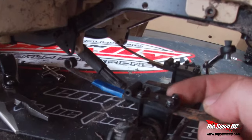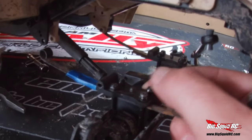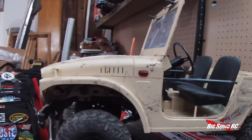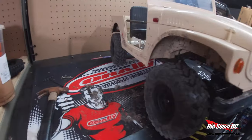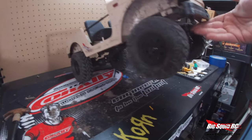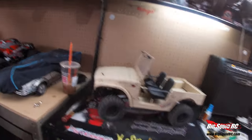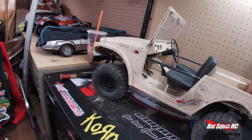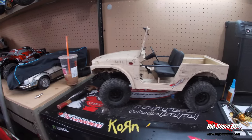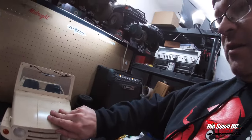These little plastic U-bolt mounts here — it's very easy to go past the thread on the U-bolt itself, so stay within the nut range, don't go past the nut; you want it to be kind of flush. This thing looks wicked now, it's got a good height to it, it's not so low. I think these will break in — they're pretty soft. Awesome little mod, very cheap — yeah, it's a free mod, you just gotta flip them around and put in some wrench time, but totally worth it. Pop the hood here.